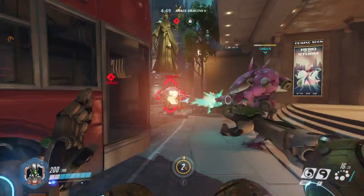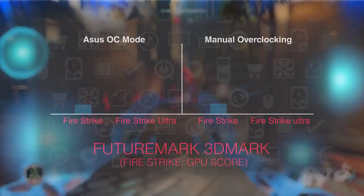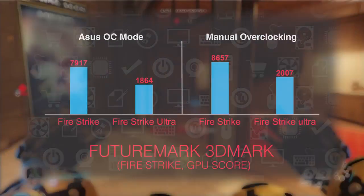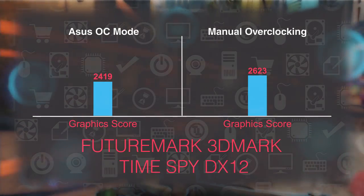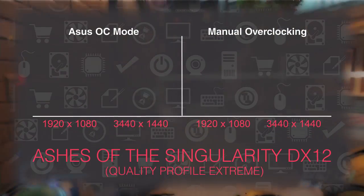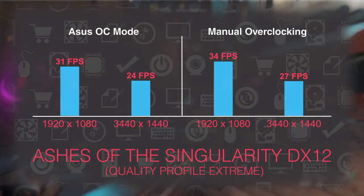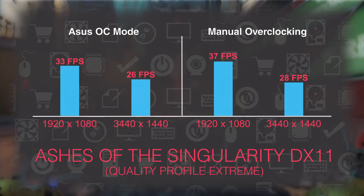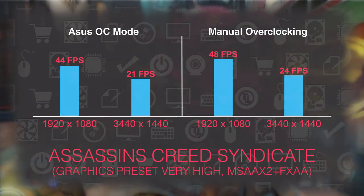Taking a look at the benchmarking results, you can see that I was getting pretty much your usual overall performance figures when it comes to the GeForce GTX 1050 Ti series. It is ideal for 1080p gaming at high graphical settings. You'll even get over 60 FPS in some titles which are better optimized, especially when you count in the overclocking. 16:9 1440p resolution gaming is also possible, judging by the figures which I was getting for the 21:9 native resolution of my monitor.